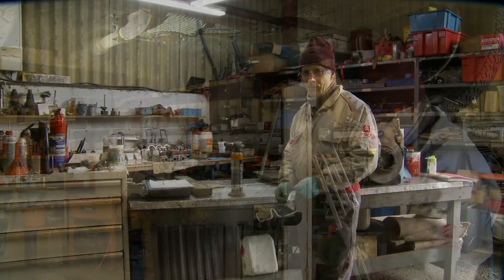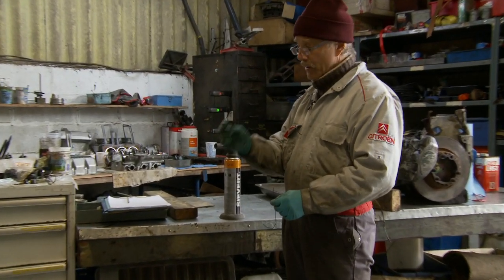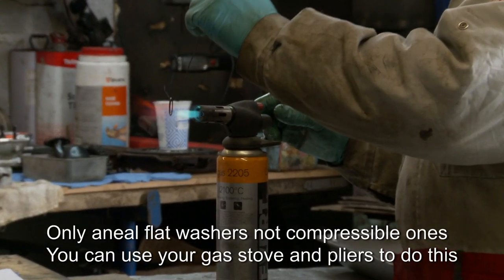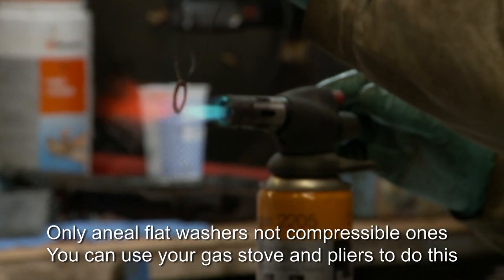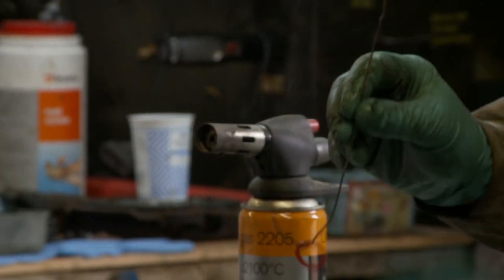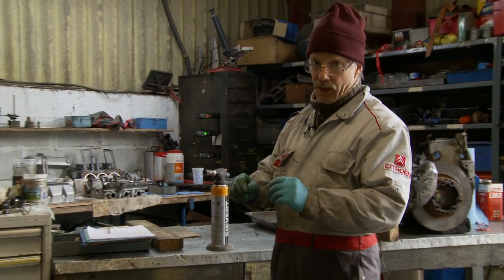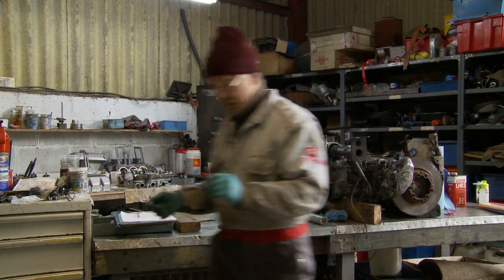It's very simple to do — I'm showing you how to anneal the copper washer used for sealing the sump plug bolt. Take a little piece of wire with a hook on it, light up your blowtorch, and all you need to do is warm it up until it reaches a cherry red colour — it may go orange, but that's perfectly fine. You don't have to quench it; you can let it cool down and it will still be annealed, but it's quicker to put it in water or oil and use it immediately.